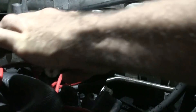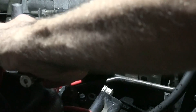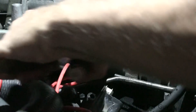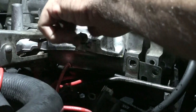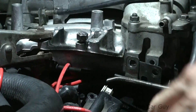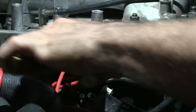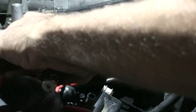Like I said, doing it this way takes a minute to weld, but when you've got to drill it sometimes it takes a while — you have to change out bits and you've got all the metal particles going down there. Now I'm going to go ahead and clean it up with a tap and put the new bolt in there. And it is out of there.